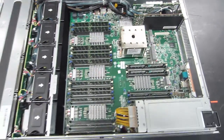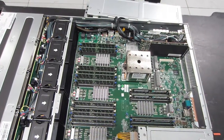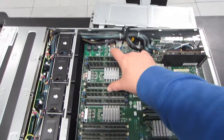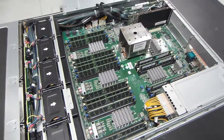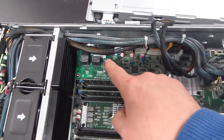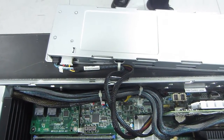The more complex RAID 5 adapter has a battery that tucks into one of the other PCI slots. The four L4 memory controllers and caching units control the DIMM slots next to them — four sets in this machine. Currently every other DIMM is missing as they don't have enough to fill all slots. In the middle is the Power 8 processor, which looks slightly golden. There's also a daughter card, with a cable running out to control the internal disks.